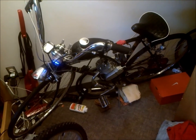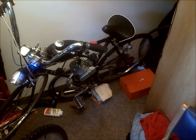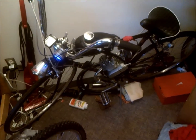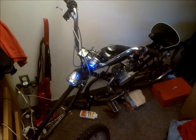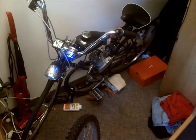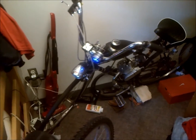It's always good to see 150 PSI or higher on your motor, and if you're trying to build a pretty powerful motor you want to be somewhere in the 180 range or above. But that's really about it — now you know.